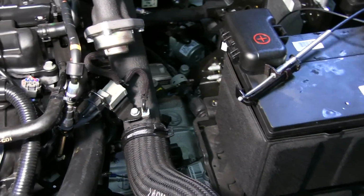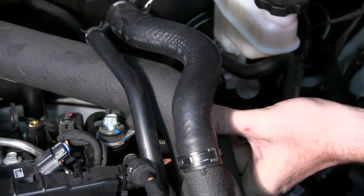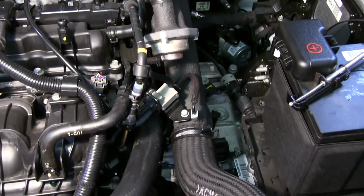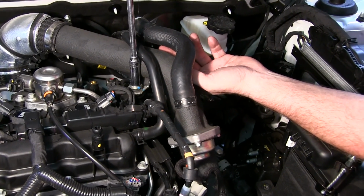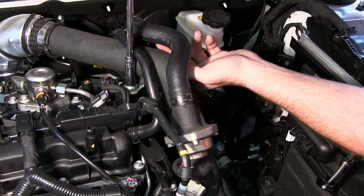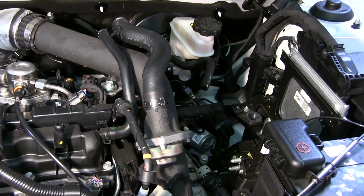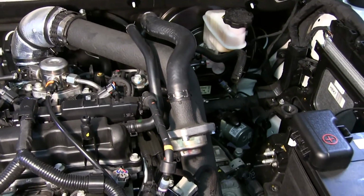Alright. And no, it will not void the warranty on this car because of the Magnuson-Moss Act. They have to prove without a doubt that it caused the damage to void any type of warranty, and the fuel converter can't damage anything unless by chance a heater hose, a water hose would come off or something like that. So that's why one of the most important things is to make sure you've got good clearances, and everything is tied down nice and tight and strapped up and out of the way to make sure that you are protected by the Magnuson-Moss Act. So your warranty will stay intact.